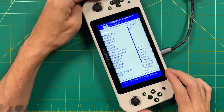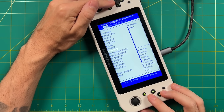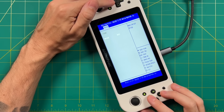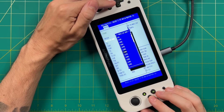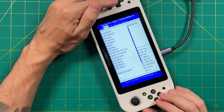To adjust the RAM timings, go into Advanced Settings, then at the very bottom find the AMD CBS section. Select UMC Common Options, then DDR4 Common Options, then DRAM Timing Configuration. You'll get a warning page — scroll through, select I Accept, then select Overclock and change it from Auto to Enabled. A memory clock speed option will appear — select 1333 MHz. Note: adjusting memory timings can cause issues and may shorten the life of your RAM stick, so there is some risk. Once you've made the change, back out to the main menu and select Save and Exit. You only have to do this one time.